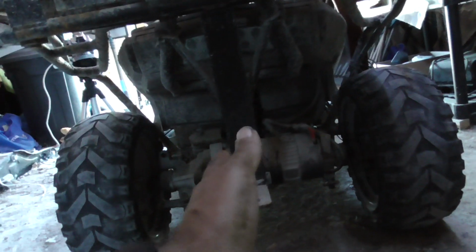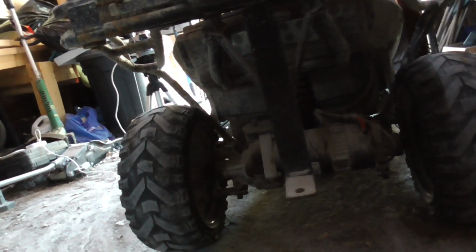The first transaxle that I had, everything fit fine, right? And then I had to replace it, and the hubs wouldn't fit completely tight. And like I say, when I'm driving, the monster's pushing down, and with the hubs loose, the top of the wheels would be angled inwards like this, and that's what's wearing my tires down, because they're not running straight right now. And as it's going around and around, that part that's angled upwards is moving around the axle, so it's grinding. And that's what's wearing the hubs out. So I'll fix that.